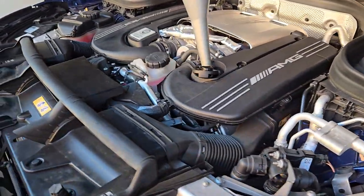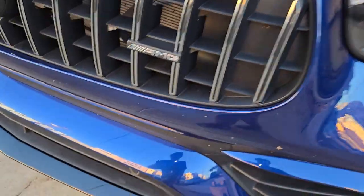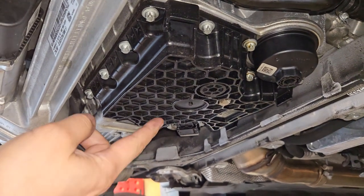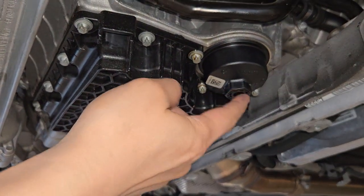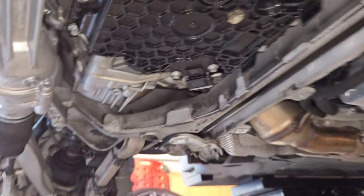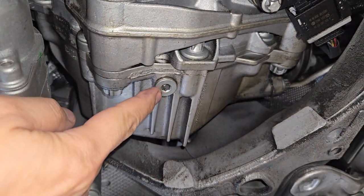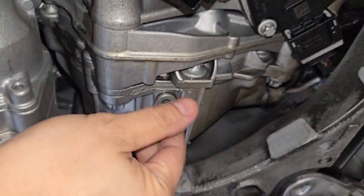That's the engine bay, and going under the usual spot — that is where you drain the oil. All nine-plus quarts of it, and there's some more hiding in here as well with the filter. That's a 24-millimeter, and that was an 8-millimeter hex. People ask about the front diff area — that's a drain plug right there for the front diff. You need a pump to pump fluid up in there, then cap it off, and you have to quickly fill it and plug it up before anything drains — it's kind of a tricky process.